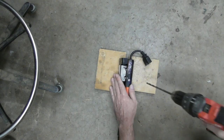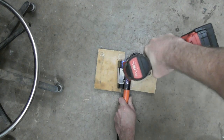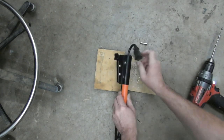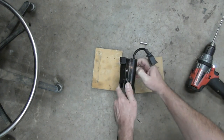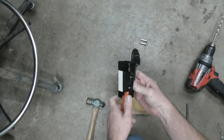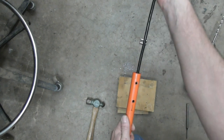I've got what I think is an appropriate size drill bit. I may need to go a little larger — I'll do this other one and then get a slightly larger bit. I went to do the back one and it popped right off. There it went — one rivet done. Got to tap that one out. There they are — both rivets out. They appear to be the same. There's the plug I was referring to — just like I thought, it only goes past the first one.